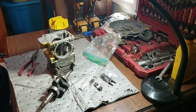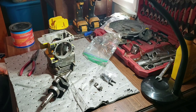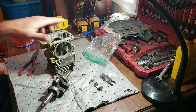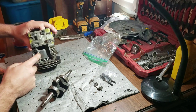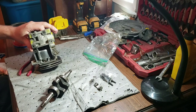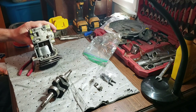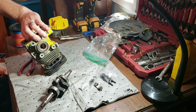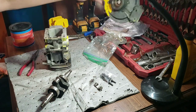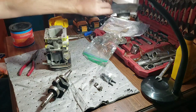Alright, project dirty 44 here. We're just gonna get started back into this - it's been a little bit. We're just gonna throw this engine back together since the only goal was to raise the boost port and cut the D-port wall open so that it can get in there. Probably could have made that flow better but we can always take her back apart. Put new seals in, got the new seal on this side and in the side cover.